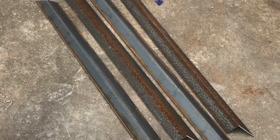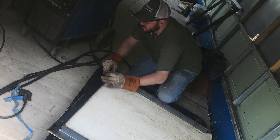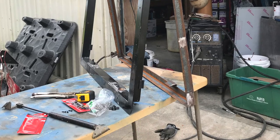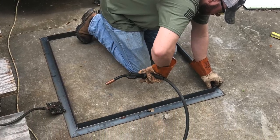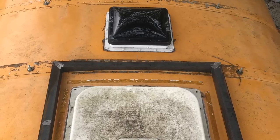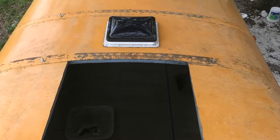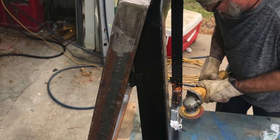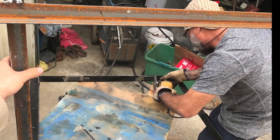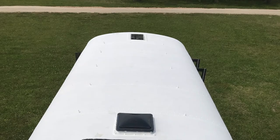of that process. Eli purchased angle iron, then had it professionally fabricated into two square frames by his cousin Tony. The arc of the bottom frame was important in order to fit with the curve of the roof, while the second frame that was welded served as the frame for the polycarbonate. A hole was then cut into the bus, the frames were hinged together, and finally welded on by Eli's dad. After everything was installed, we painted the roof with a sealant.